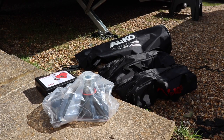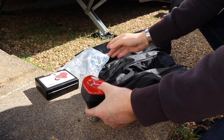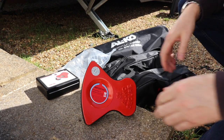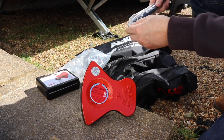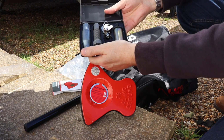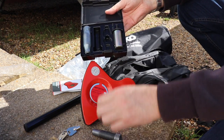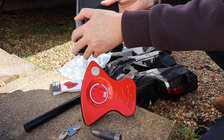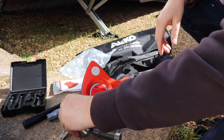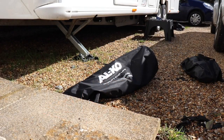Here's the kit. This is a new van from Bailey and it comes with the full kit ready to install. This is the red axle lock itself, or at least one of them. See the red sticker on there — that's informing you that you should register the lock once fitted. Also in the bag is the wrench for you to do the nut up when you tighten the lock onto the axle. Here's a little accessory box with three items: the nut, the keys obviously, and the nut that goes onto the wheel that helps you tighten the nut, and then the brass locking mechanism with a dust cover. That's the whole kit that we need to fit — times two because it's a twin-axle van.